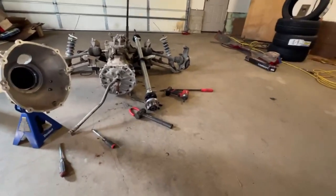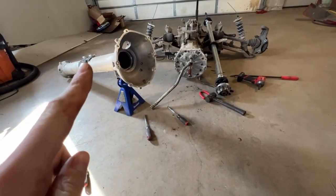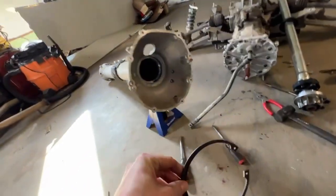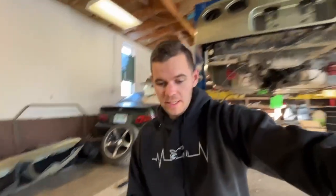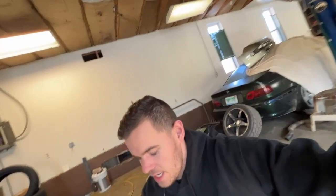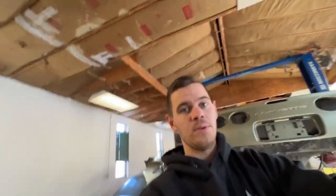What's up guys. I spent the last half hour getting the torque tube off and getting the inner drive shaft from the torque tube removed. You can see the drive shaft came out of the torque tube. The biggest thing with this is the snap ring on the inside here — it's definitely a bitch to get out, caught myself pretty good. But it's out and you can take a look at the couplers — they're definitely not great.